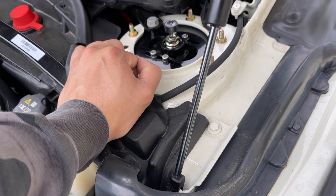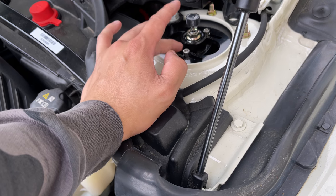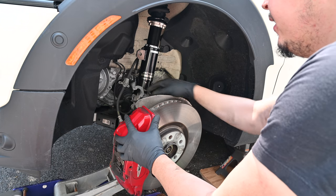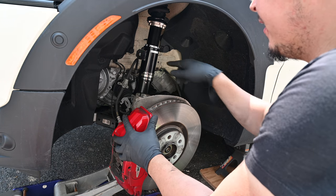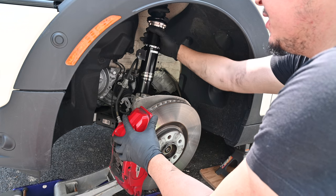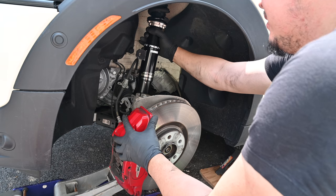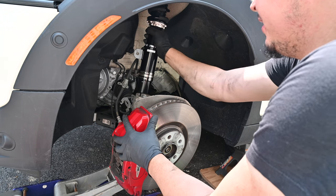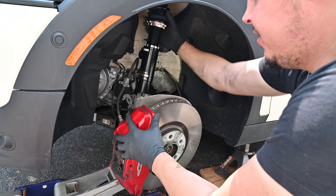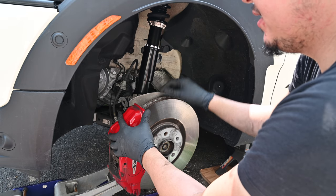Just as a quick note before we continue - don't forget to tighten the camber kit bolts up here. Getting ready to assemble the front, just make sure the little nipple is facing the back. It's a little bit of a shame that the sticker is going to be put away but I'll know they're BCs and that's good enough for me. Rotate it so that little guide pin is matching up with this back here, like so, and then use the jack to raise the knuckle.